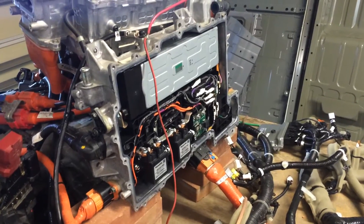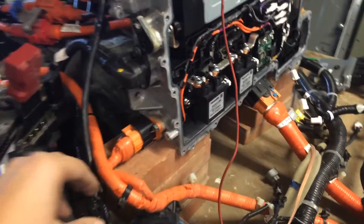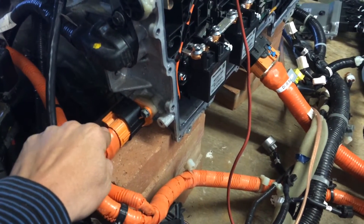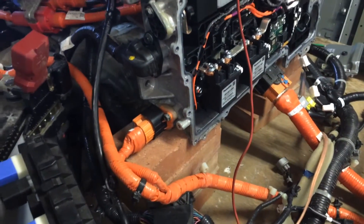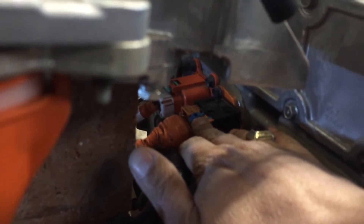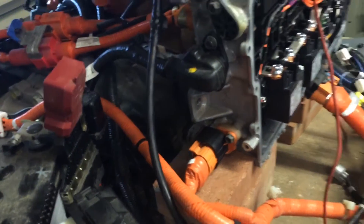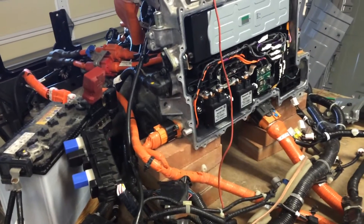That's why the cover is off the DC junction box and the charger back there. It turned out to be a simple wiring error. This connector here is the DC high voltage connection between the charger and the DC junction box, and it was miswired. There's another connector on the back that's exactly the same type — that one is for the heater. I had the charger connected to the heater connector, and the heater connector plugged into the charger port on the side of the DC junction box. That's what was preventing charging last time.